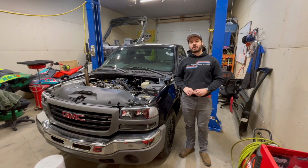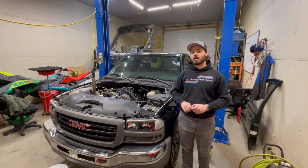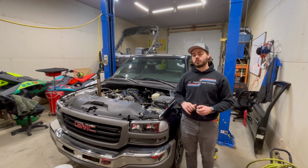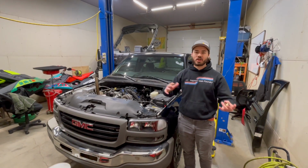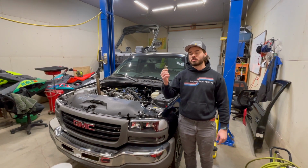Hey guys, it's Alec Agard coming to you with another YouTube video. We are in the shop working on the Turbo GMC, and today I'm going to show you how I will be triggering my second fuel pump, because this truck has two 450 liter per hour fuel pumps in the tank, and you don't necessarily need that for driving around if you're less than, say, 6 or 8 pounds. You only need one. We're going to be triggering that second pump today with this Hobbs switch. So we're going to be installing this, and I'm going to show you how this works.